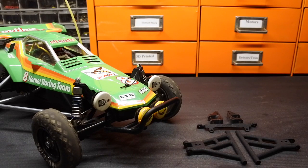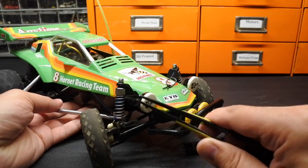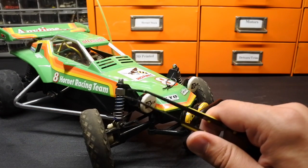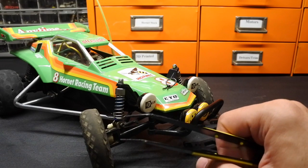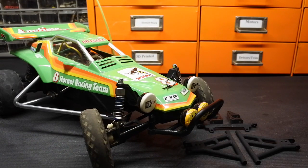I've done a couple of these installations. The one we're going to focus on here is the Zero Offset Front Suspension. The Zero Offset is referring to the spacing of the base of the shock. This car does have an upgraded front shock absorber — this is a UG unit. Everything I'm going to talk about is going to work the exact same way for something upgraded like this, maybe one of the CRP units, as well as the stock front springs.